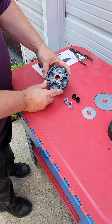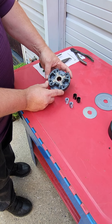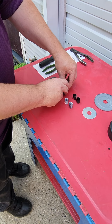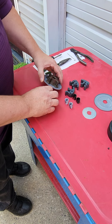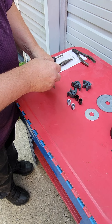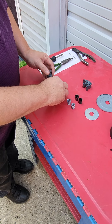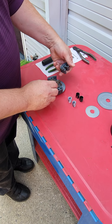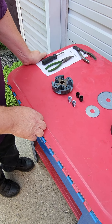You're welcome to experiment with that — that's why we have a lot of different options and adjustability in the Hilliard Bully clutches. What we're going to do is sit in the most aggressive inboard position. Take these back out — inboard, this drive hub will be in this direction, so these shoes would all go in that orientation. Now we're going to need to install the springs.